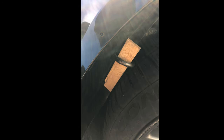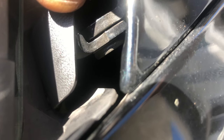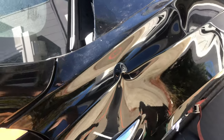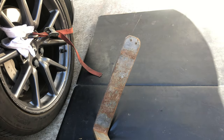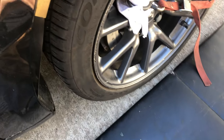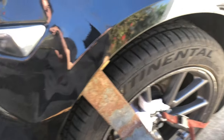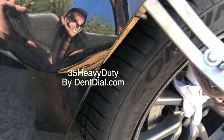That's how quick PDR can begin. Looking around, I remembered from the estimate there was an opening at the top, so I double-checked and sure enough there's a hinge I can pry off of to get strength really close to the heart of the dent — that's important for accuracy. For this job I brought along some history: years ago I bent a truck leaf spring, drilled holes in it, threaded it, and that was my first tool for pushing out big dents on fenders. I abandoned it because it didn't have all the angles needed, but you can fix dents with any tooling — it's just more cumbersome. I eventually couldn't find what I needed, so I made my own — that's when I came up with the Dent Dial.